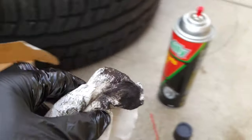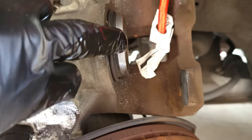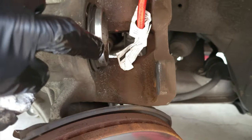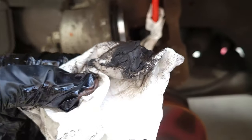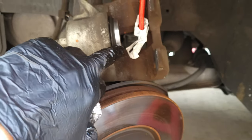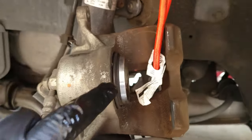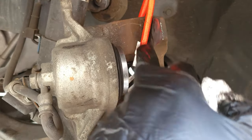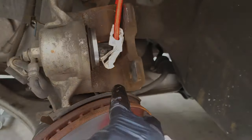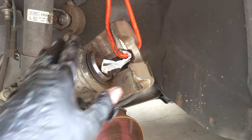For the next guide pin I'm going to put some caliper grease on it and slide it back in. I also sprayed some brake cleaner on a clean towel and cleaned around the piston — you don't want to spray directly on it to avoid getting brake cleaner on the rubber component. Just look at how much came off — this slides in and out and goes into your brake line. That little extra effort can prolong the life. I'll hit this with just a little wire brush to get some dust off.